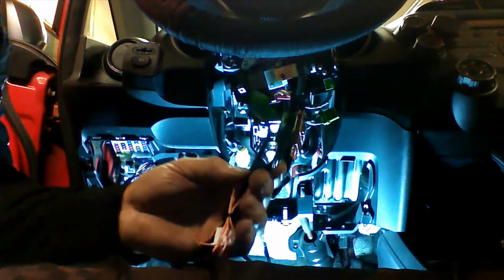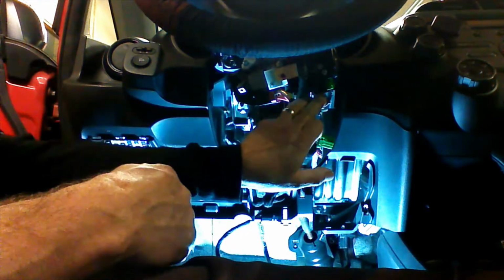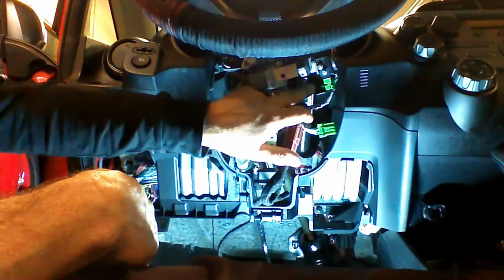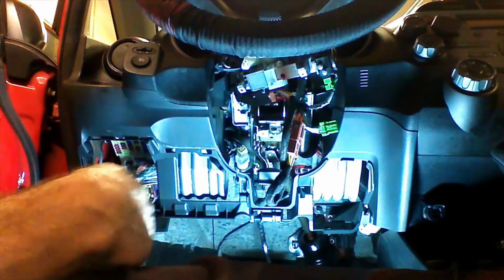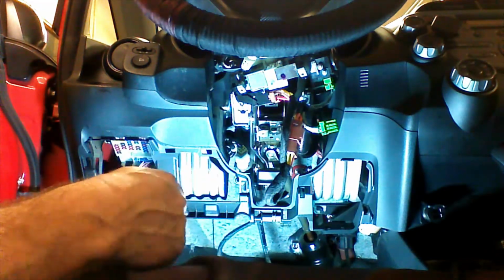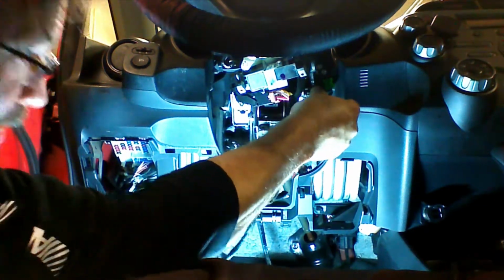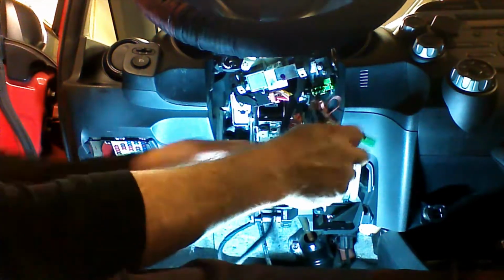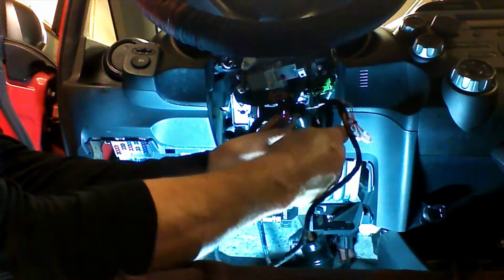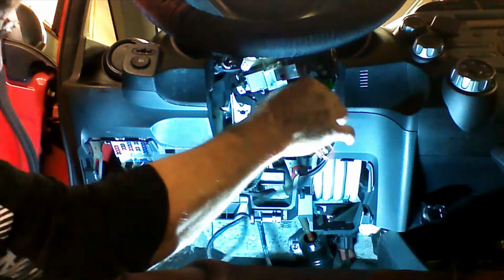We're going to install the immobilizer portion. We've already removed the green plug from the bottom. Some vehicles, this plug can also be white. So not necessarily, we're going by the location of where it is. So the color is kind of irrelevant. I'm going to go ahead and plug our immobilizer into the vehicle's immobilizer plug. And then we're going to plug the plug that we removed from the immobilizer plug originally into the other side of our T-harness. We're going to make sure all plugs lock, always.